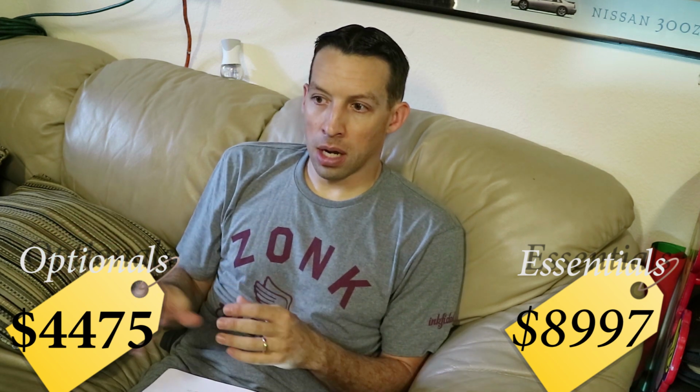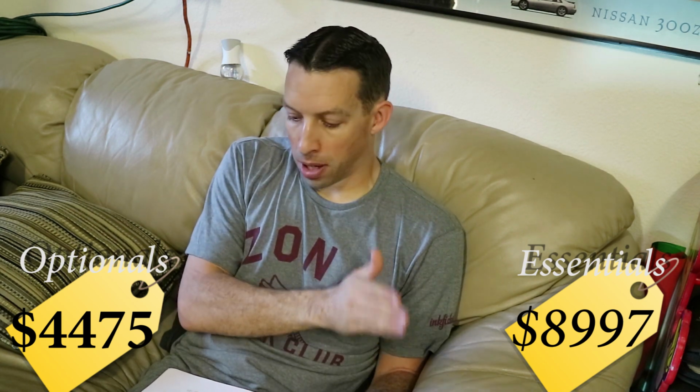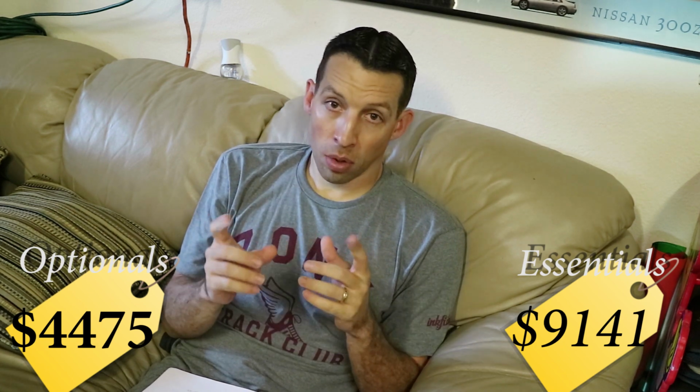Now that I've got it working, I'm going to go back and build a better custom exhaust. But for the sake of getting the swap done and getting it going, you can buy one of those Y pipes off of eBay. I paid $144. You're going to need a Z32 catback exhaust, particularly one with an X pipe.